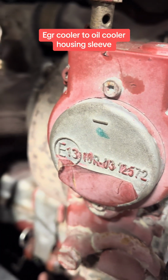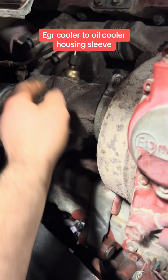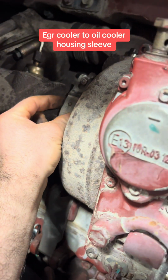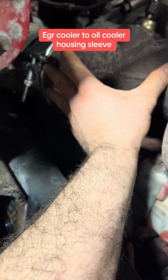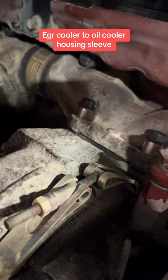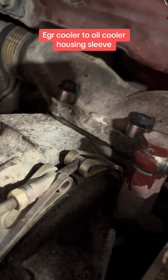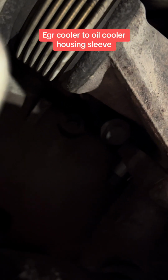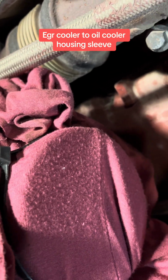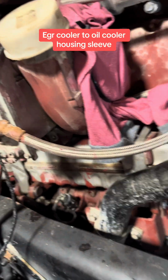Is that what they call this one, diffuser? I can't remember anymore. I think this is the diffuser, yeah, with the 7th injector. Pretty sure it's diffuser. Yeah, take this off. You can actually just take this off, but to get to that clamp, I just take this section off. You can see I have new clamps already. But yeah, then these bolts are always pretty straightforward to take out. Up there, regular wrench. Then down there, I'll actually use my ratchet with the swivel head. And on this side, I'll come in with my super long Snap-on ratcheting wrench that swivels. I bought it for the Cummins turbos, to be honest, but now I'm using it more on Mack.